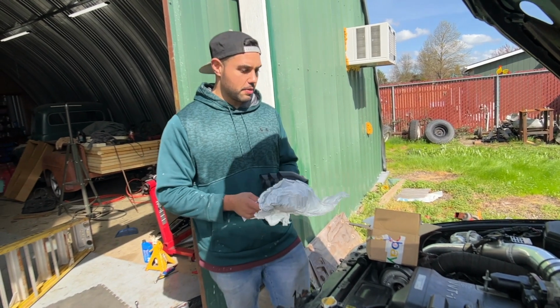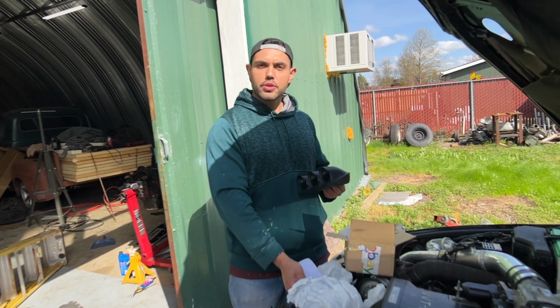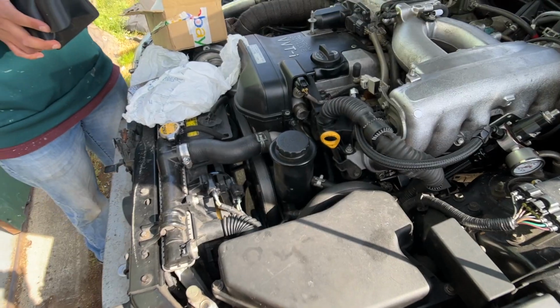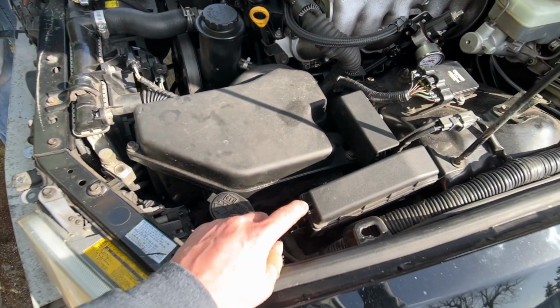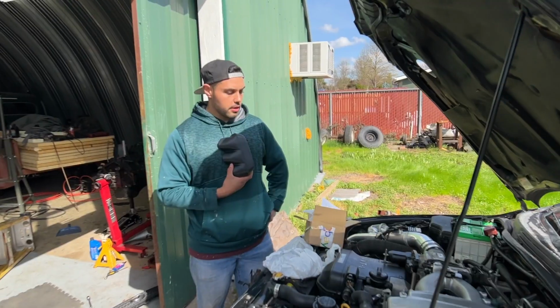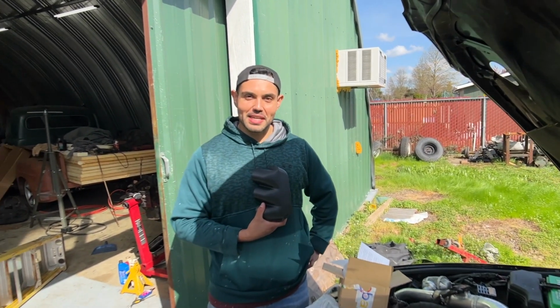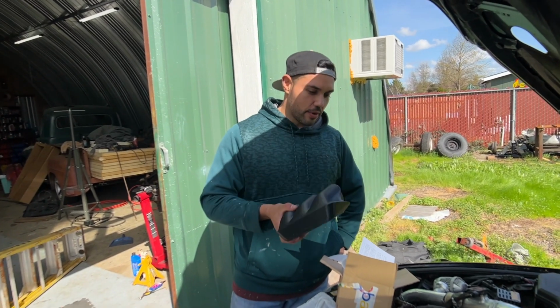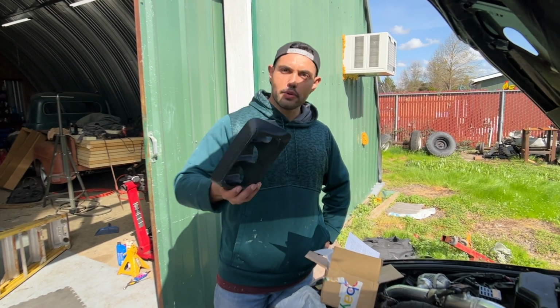Fuel pump isn't keeping up. Matt just cut some wire in there. I cut the wire that triggers the fuel pump relay to lower the voltage. And we think the turbo's maxed out at 5 pounds, if that. Matt put a bigger spring in it. We got it up to 10, but it drops all the way to 4, right?